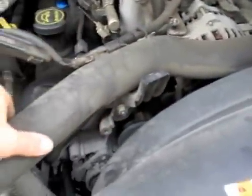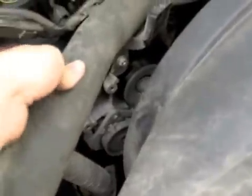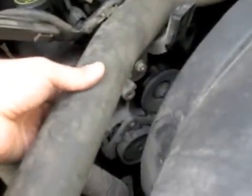I answered a question this morning about when to replace radiator hoses. This radiator hose — if you look at these clamps, see the way that clamp is? They put that together with pliers and it snaps closed. They use these predominantly at the manufacturer, not in a replacement setting. You'd throw these clamps away and replace them with a screw-type clamp. If you see that type of clamp on your radiator hoses, it tells you this is original to the vehicle. These hoses really ought to be replaced — at 7 to 10 years, you probably ought to replace them. Sometimes you squeeze them and hear a crunch and crack noise; that's rust, lime deposits, and minerals built up inside, and that's a good telltale sign it's time to replace them.